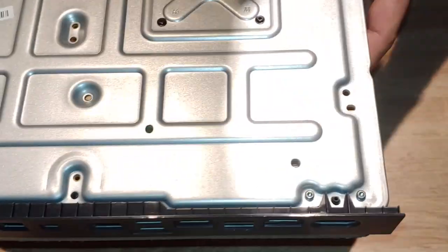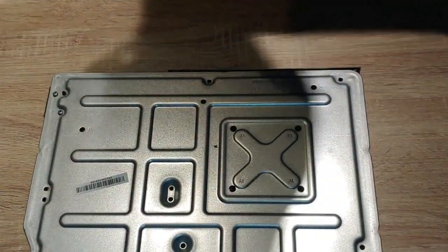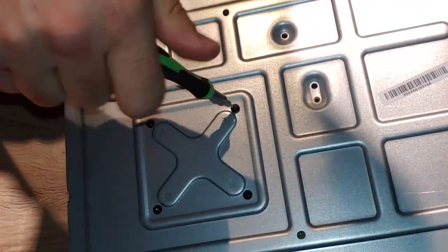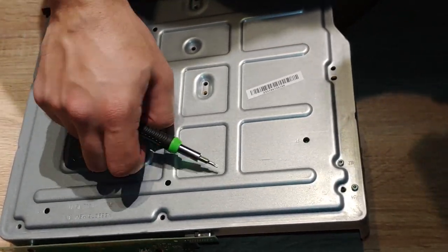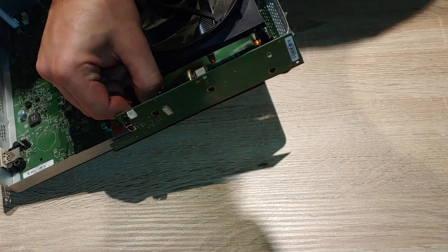You shouldn't have to worry about your fan falling because not only is it screwed in, but it's got that infamous X-clamp — the Xbox has an X-clamp. So we will undo this. Looks like Torx 8 once again. We're just going to remove our screws right here. Looks like there's two here, two here — these pop right out. Remove these front three, these look like the same screws we removed from the back plate, there to hold the fan in place. Carefully slide that out.